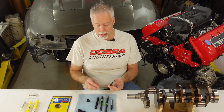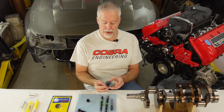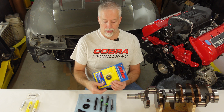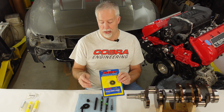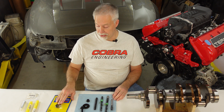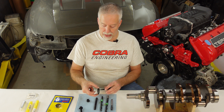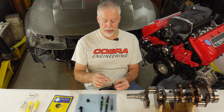The only other thing you're going to have to do is this washer. I'll put all the part numbers on CobraTechTalk also. It's going to be too big a diameter most likely — it's the right inner diameter, so you might have to cut the OD down depending on your dampener. Or if you have this washer you can open the hole to a 9/16". Those are actually very hard — I wouldn't try using a drill bit, I would use a lathe or something. That's why cutting the OD for me is a little easier. I'll put that on the stud and run a nut on either side to clamp it, put that in the lathe, cut the outside.